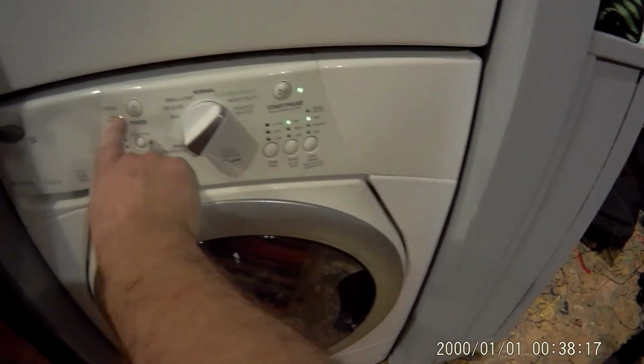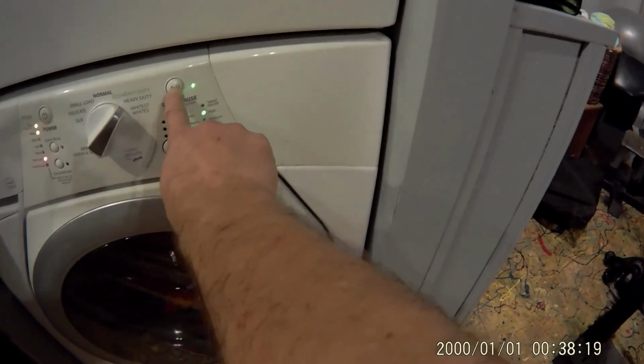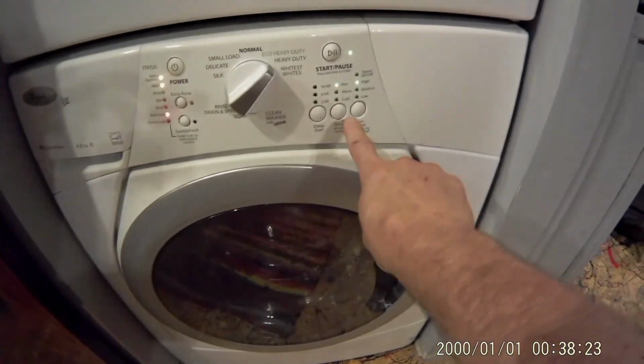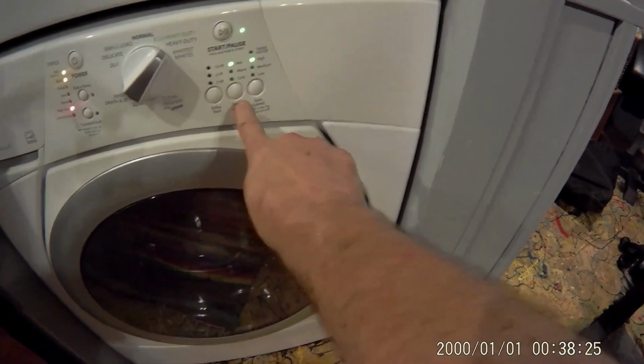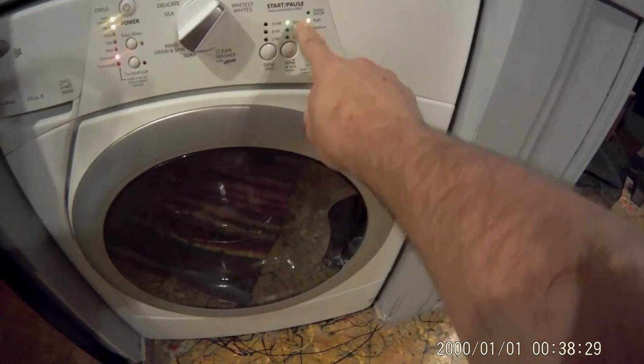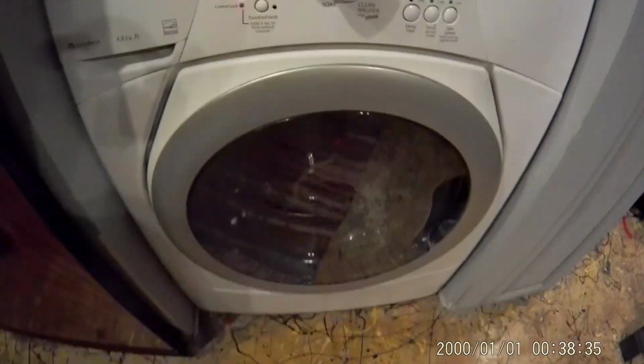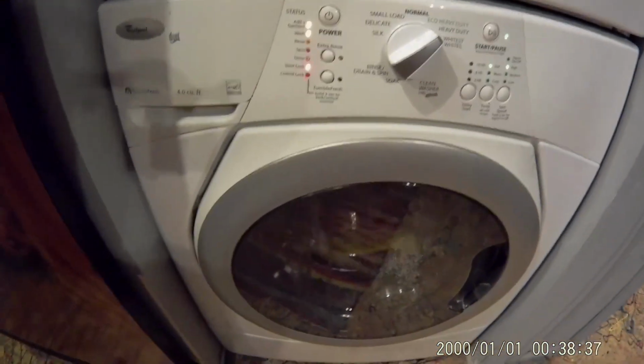before the wash starts, you push the power button on, then you select cold, okay, because the oxygenator does not work unless it's cold. You'll just wind up doing a regular wash without detergent. And then you can select tumble dry, extra, whatever you want. And then when it's done, you put the stuff in the dryer. Self-explanatory, I'm over explaining this stuff.